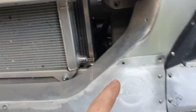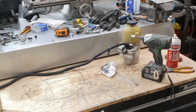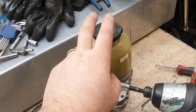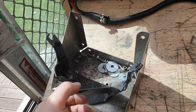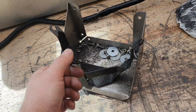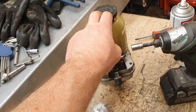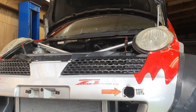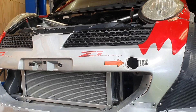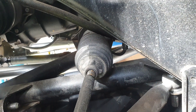We got as far as there's a panel that lives in here. On the back side of this panel was the power steering pump. That pump plus the hardware plus the panel — six and a half kilograms. Are we trying to make this thing lighter? I've looked into whether we're ditching this and going with other systems. The K12 March standard comes with an electric steering column, so the rack is essentially a manual rack with no hydraulics and no plumbing to deal with — smaller and lighter.